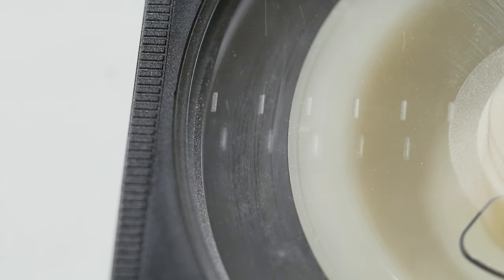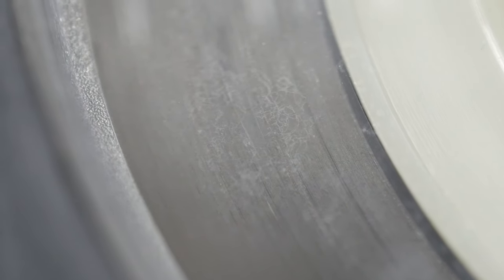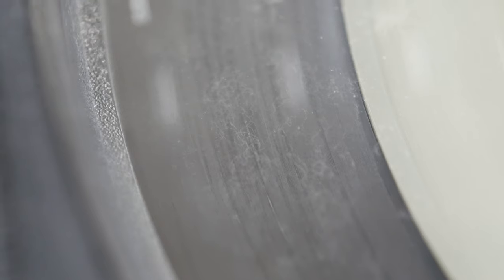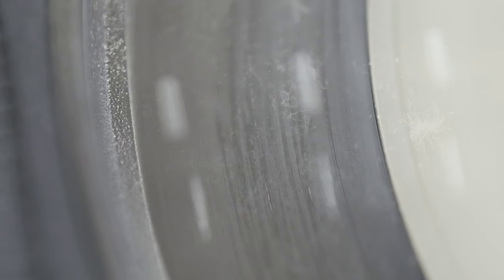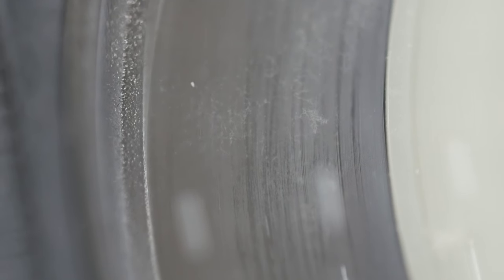So how did we do? I think pretty well. The mold has gone from the top of the tape and hopefully also the surface of the tape. If you look very closely, you can see little white spidery spindly etchings in the plastic—that's not mold, it's not on the tape. It's just etching into the plastic that the mold made when it was growing on the surface. Overall, this is a very clean tape now, and for a consumer making a consumer archival effort, I think this worked out very well. This is the method that I use personally.